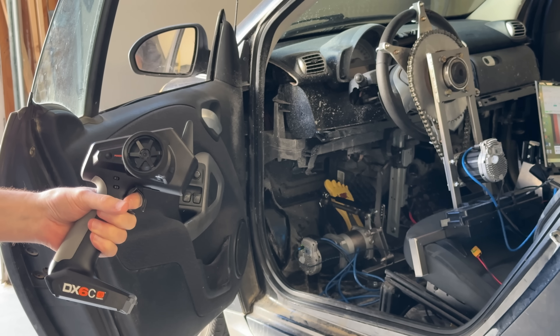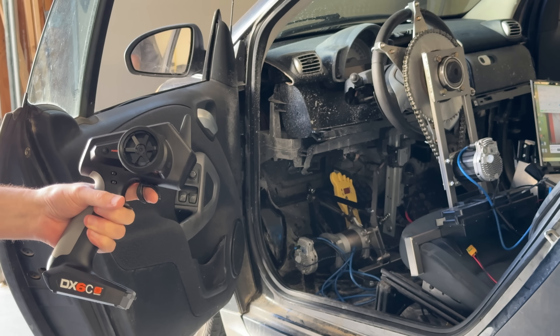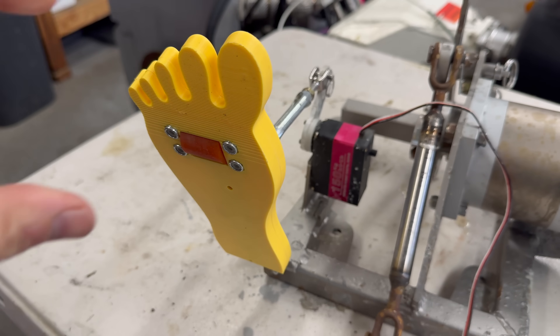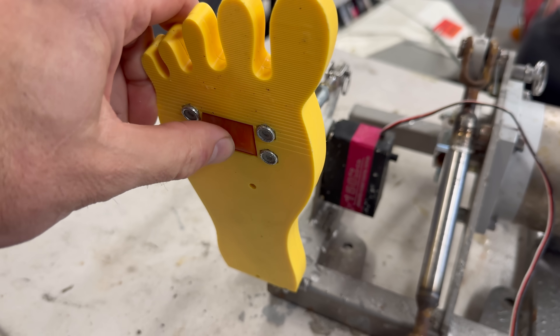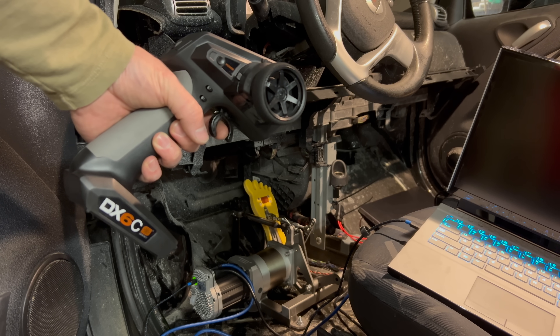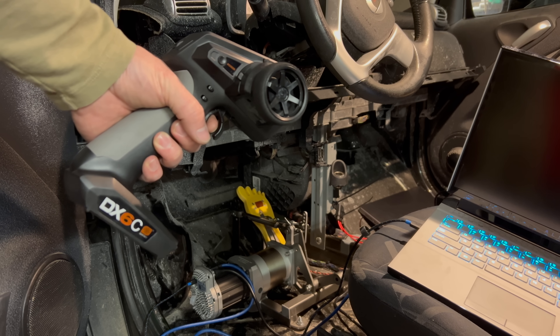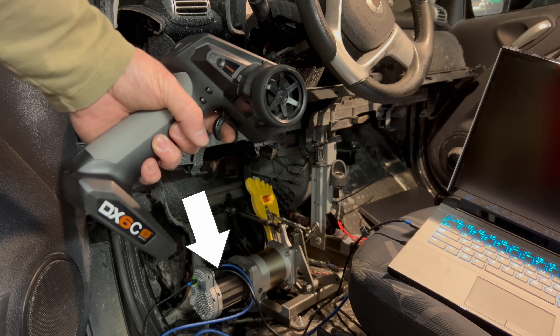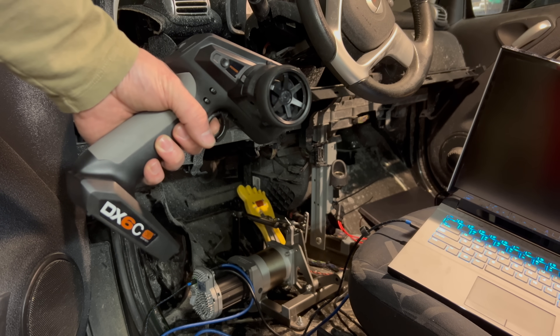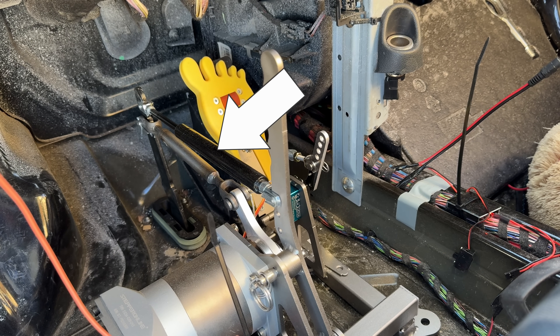The accelerator pedal servo is made for radio control vehicles, it's just on the very big side. The pedal has a spring in it, but it's not that heavy, so we just need a little bit of force to overcome it. Obviously this has to interact with the existing pedal somehow, so of course I 3D printed a foot to press on the pedal. This foot has a roller inside to roll against the pedal and reduce friction. The brake actuator is a little more complicated. This uses a much bigger servo motor with a gear reduction on the end. This can output a bunch of torque — plenty enough to lock up the brakes — but that's not what it does. If you remove all power from the system, the gas strut here will back drive the motor and press the brakes so the car will stop.